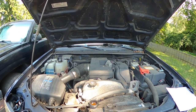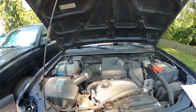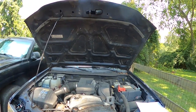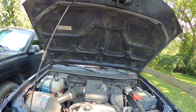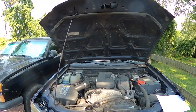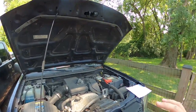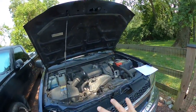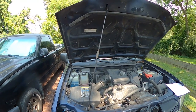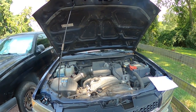After about 20 minutes I'm going to drain everything out and look at how discolored it is. If it comes out and it's not clear, that means there's still stuff in the system. I'm going to refill with more distilled water — that's why I bought five gallons. I'm going to do the cycle again, drain it. The challenge is you can only remove this cap and work on it when it's cool. After I've run that first cycle of distilled water, I'm going to have to wait for it to cool off. I'm hoping to get the fluid drain and the first set of distilled water going through and finish it tomorrow once everything's cooled off.